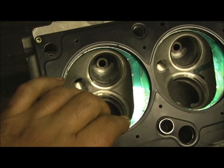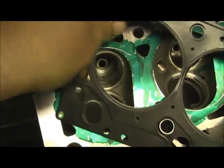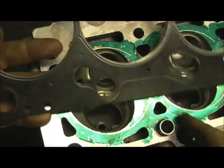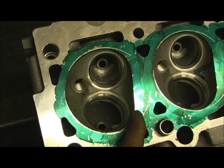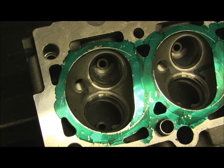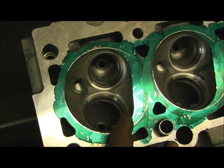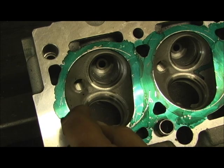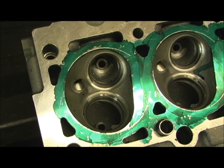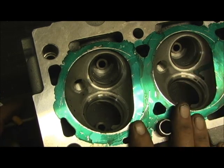I just wanted to show you how I'm going to do it. This is the gasket system — it's one of them MLS's. I had to kind of create my own dowel pin to lock this down; I took some big block Chevrolet dowels and conformed them so I could get a good anchor. I can come in right here, make a little bit of a swoop, and this will lose just a touch of compression, which is okay because I want to lose just a little anyway for carbon buildup later on. The customer wants to keep this for a while, so I clear all this out, roll over that hump, and blend it. That combustion chamber work will net some good thermal energy conductivity and help make a little better gas mileage.